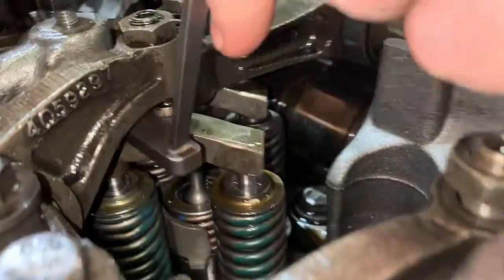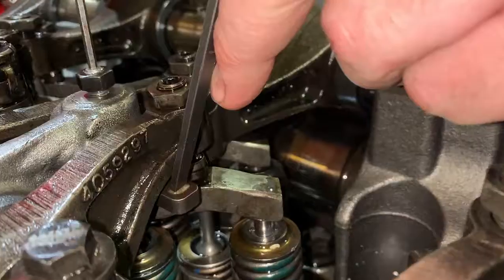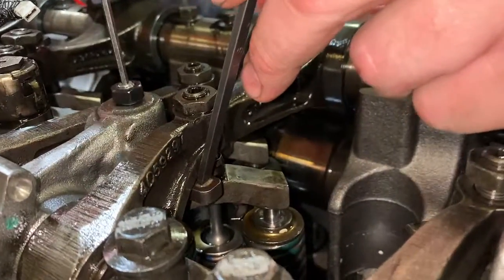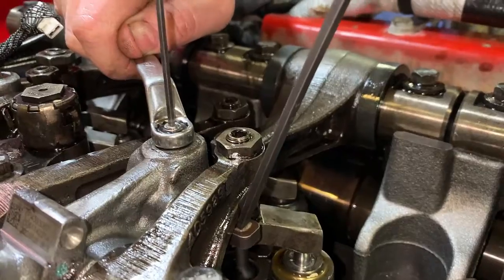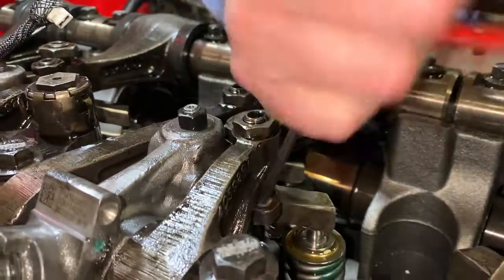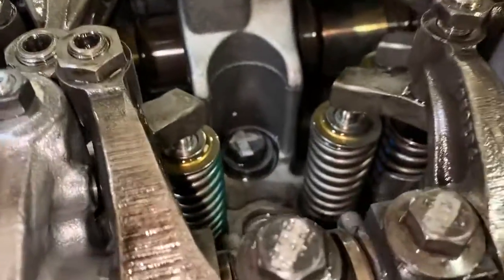Here we're setting the jake — that's a seven-millimeter shoe for this engine, and the crosshead has a pin in it, and we are going between that pin and the jake lever. When the jake's actuated it only opens one valve. You can see to the right there that the valve at the bottom of the screen doesn't get moved — just the one in the back — because that crosshead's got a hole drilled through it. When I identify parts in another video you'll see that.